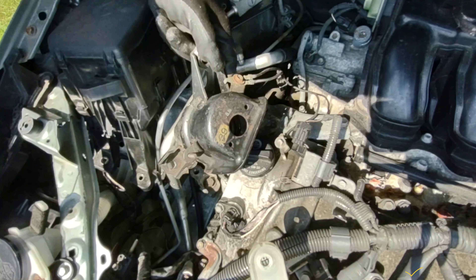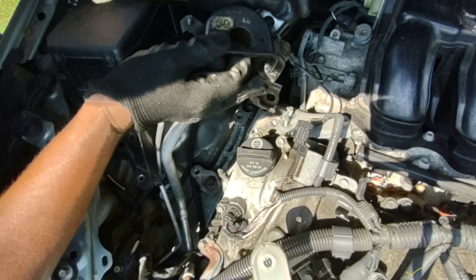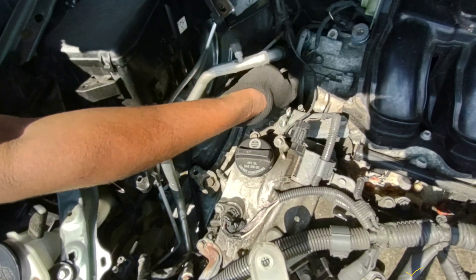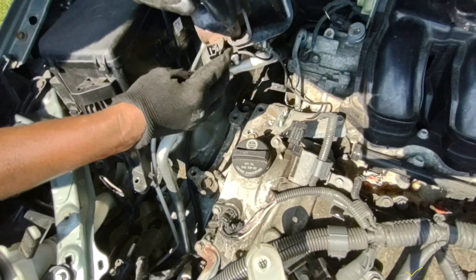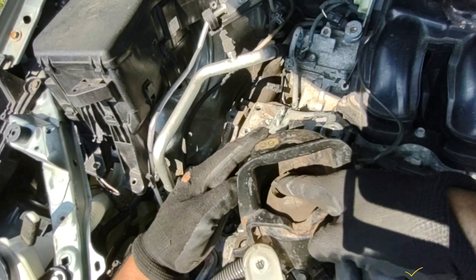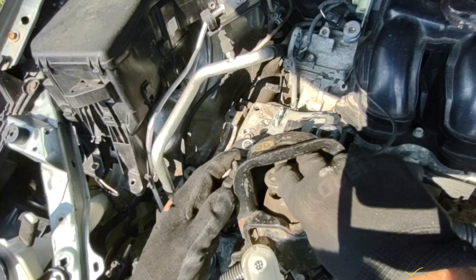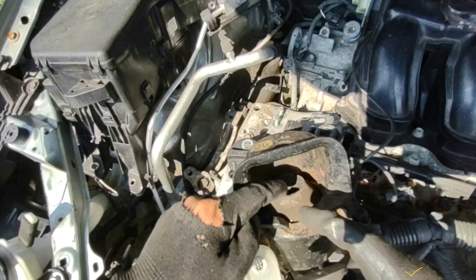There's a 10 millimeter bolt here — a small bolt. I tried already but it seems like it wants to break, so I'm gonna take it out from here and disconnect it. It just has a tab here and I unbolted it from here. I'm gonna put the bolt back here. This part came off completely — it's supposed to be one piece; it's not supposed to come apart.